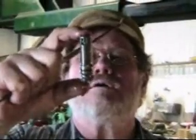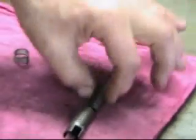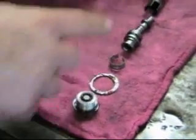The first thing we're going to do here is take out our oil pressure relief valve. This is a three-quarter inch socket — it's just a cap. There are springs and balls behind it but they're not going to pop out. I'm going to use a hook — I've got a scribe here with a hook in it — and go up inside and hook onto the valve and pull the valve out. Here's the valve. We'll go over to the bench and clean this stuff up. Here's our oil pressure relief valve. This is the low pressure relief valve at the top of the unit. The spring that actually forces the valve down into the housing. The filter screen at the bottom. The washer that was at the bottom. And then the plug that goes at the very base and holds it all together.